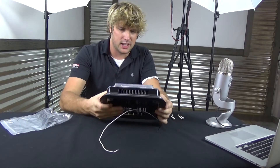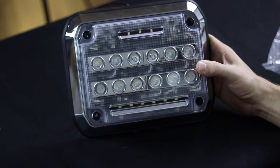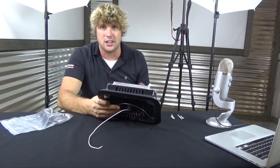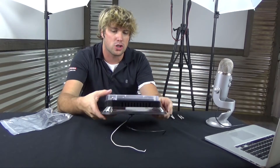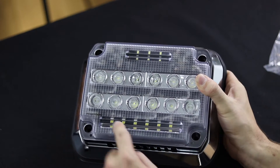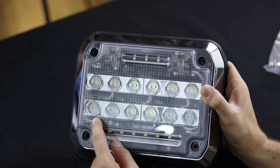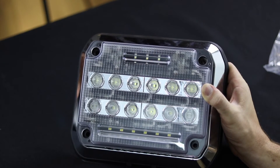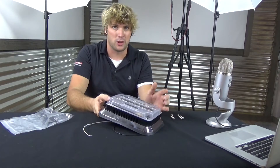Now that we've got the light out of the package, if you're looking at the fixture, we've got this crystal clear Covestro lens. The light circuit at the top — these two pieces are designed to give you light out from the fire truck, illuminating mailboxes and that sort of thing. These bottom two circuits are articulated down, so that's lighting the area midway in the fire scene. And then this bottom section is lighting down the side of the body and near the fire truck, covering the whole area near the outer edges of the apparatus. The Guardian Elite is a little bit larger circuit board but not a larger fixture. The bottom chips on the Guardian don't have a primary optic — a little silicon dome — whereas on the Guardian Elite you'll see that primary optic, and the upper chips are actually larger on the Guardian Elite as well. The center row of chips is the same. We do change the optics depending on where they're designed. The Guardian fixture is specifically suited for the back of the ambulance body or side loading doors — recommended in areas where you're looking to reduce glare but still improve visibility. The Guardian Elite, with the bigger bottom and top row of chips, gives you more light output which just floods the area.